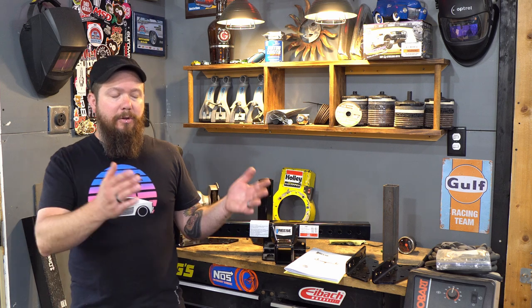That's one of the things I did a clip swap on this thing, where I chopped it off and I put an S10 clip on it. The steering setup on these from the factory is dicey. And when you put a lot of weight on the back end of it, it's going to make the front end lighter. It's going to make the steering even a little bit sketchier. So you want to be very, very careful about what you're going to be towing behind anything like this.